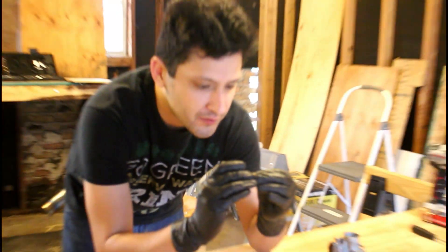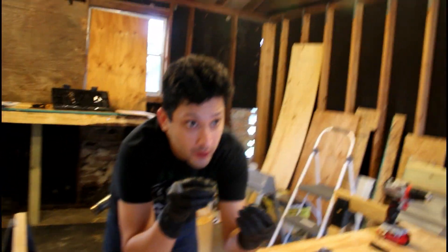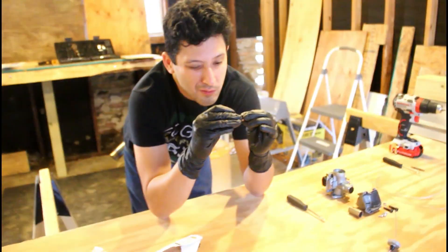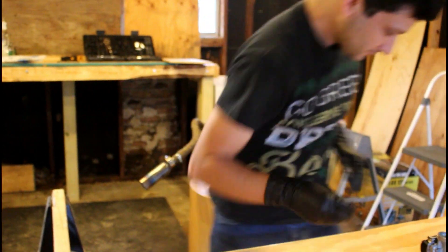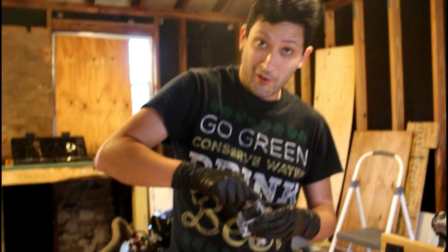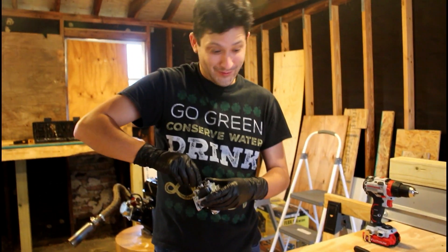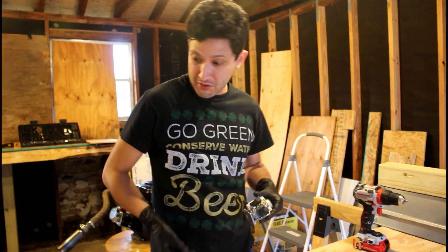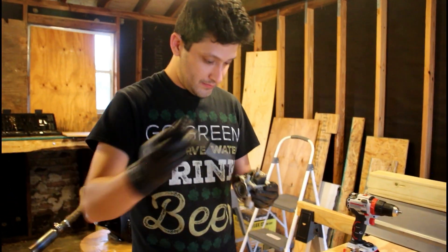I want to see if that's in any way comparable in size to the jet we're running. Hopefully it'll work; if it doesn't, we know what's wrong. Now we have to remember, this is not a number 95 jet anymore — this is bigger than a number 130. And if this doesn't work, I'm just going to go find some new jets. Be sure to remind us in the comments next week if it was in fact that size.